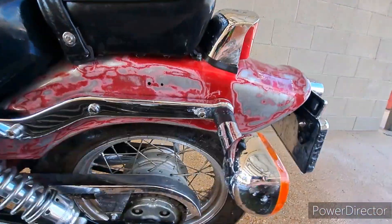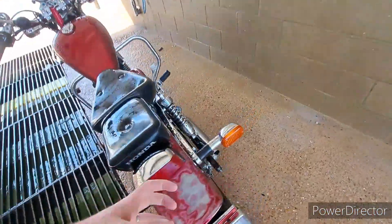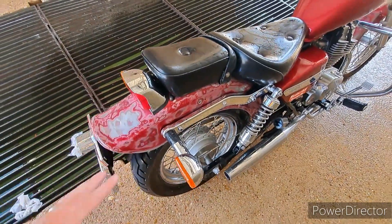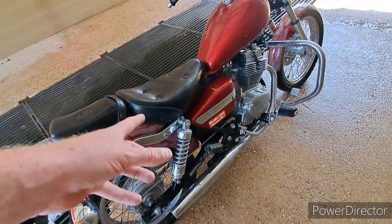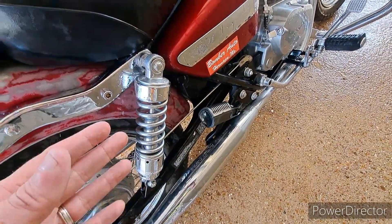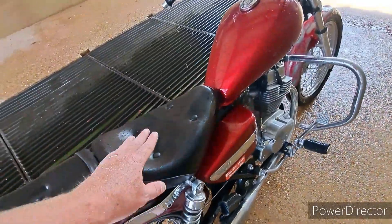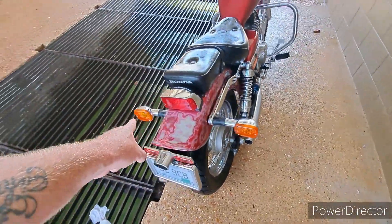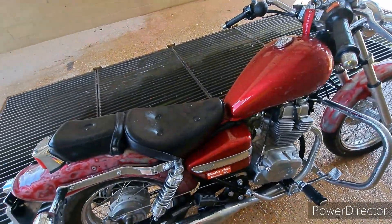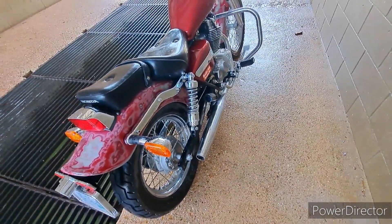I brought it here so I could rinse it and get that red dust off the fenders. I actually removed the whole fender off the bike — I kept the turn signals and all that stuff together, but I removed it. I popped off the shocks which dropped the frame, and I pulled the wires underneath the seat, disconnecting them — which were on the brake light, the turn signals, and the license plate light.